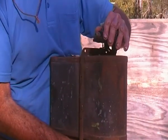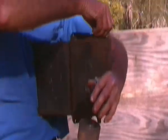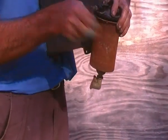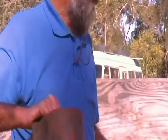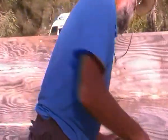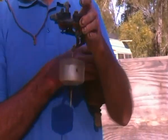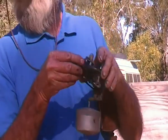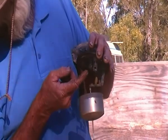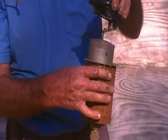You have these two in here — that's your storage part. In that one it's the bottom half; in this one it's quite large. When the float's down, this little valve is closed and that one there is open. That one allows engine vacuum into this top chamber in here.